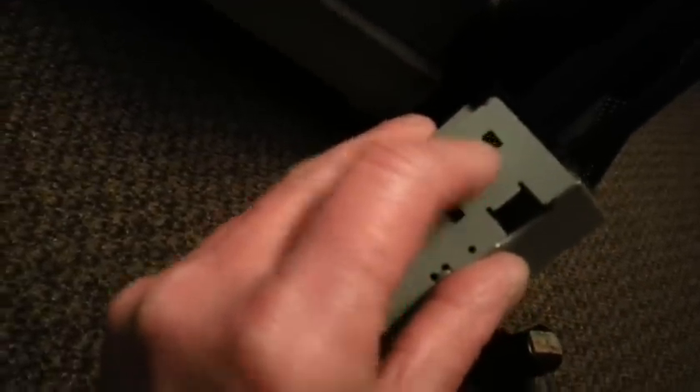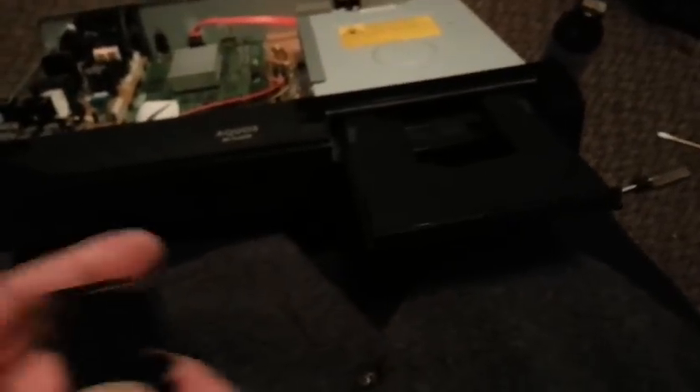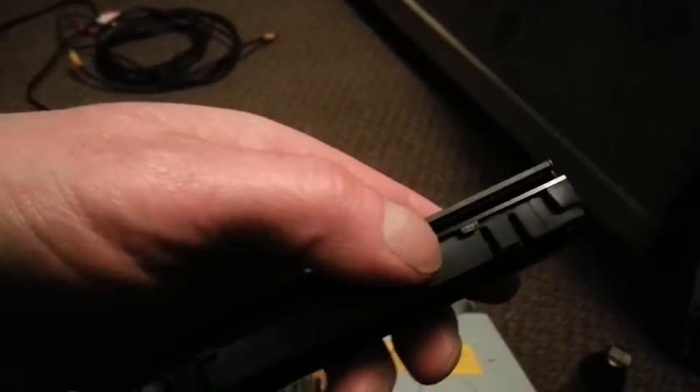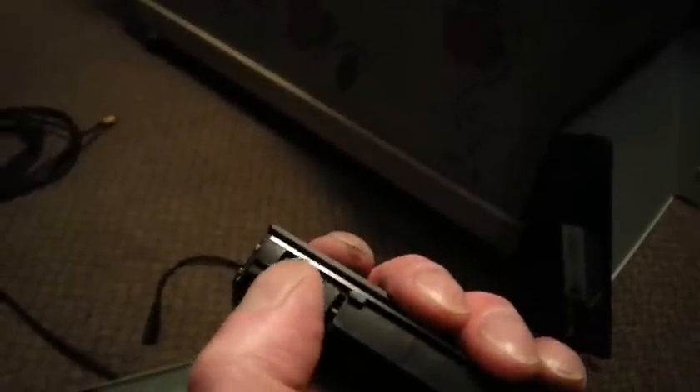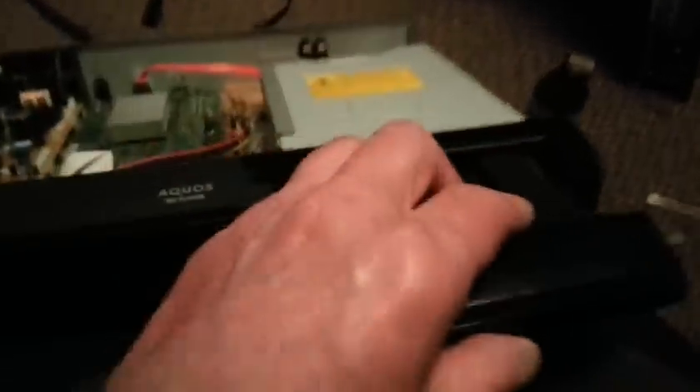Take a better look at it. In this case there's a little peg right there that you've got to push in, and another one on the other side. It usually clips in on top here too. This step is usually what buggers people up. If you look at this, there are slots right in there — the actual drawer slides in here. This goes up and down going in, so I'm just going to line it up.